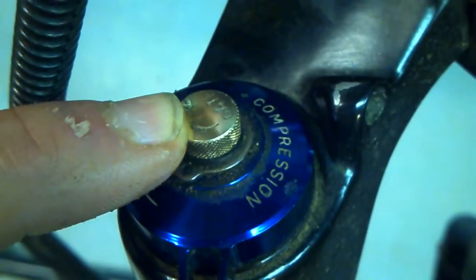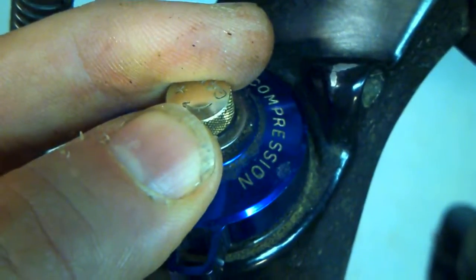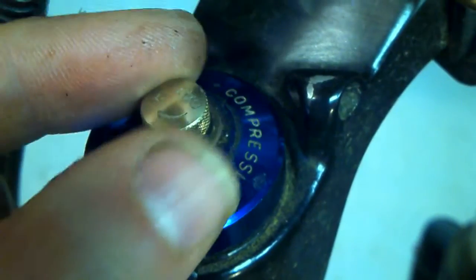Now on the other leg, you have adjustable compression. This is the compression setting. This is really designed to be on or off. And then there's a gate control that, as far as I know, RockShox is one of the few that have it. The gate control configures the threshold before the fork starts to go into its compression stroke, so you can adjust that. On the bottom of the same leg, you have a rebound knob right there. Let's see if I can get that better. This rebound knob adjusts how quickly the fork rebounds from the compression stroke, and it's fully adjustable.